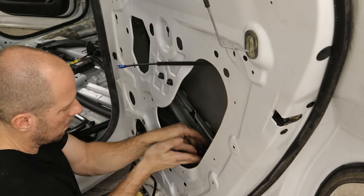We decided to use the excessively long screwdriver for the sun visor clip — probably just so the experts could tell me it was not required for the job. Now we can throw our quarter trim up there, push it up and it clips in. There's a screw in the D-pillar and one in the C-pillar — put our little caps back on. On the other side, I never actually took that quarter trim out of the car because I could not get the seatbelts to come out of the floor. GM uses an excessive amount of Loctite, and with a little bit of rust they never come out again without heat and prayers, so I just work around the quarter trim.